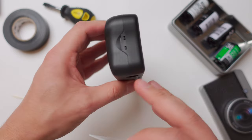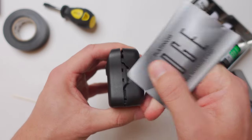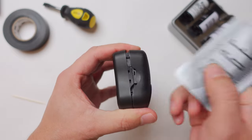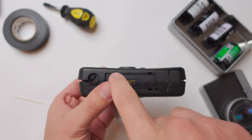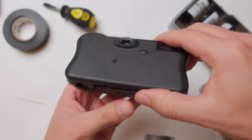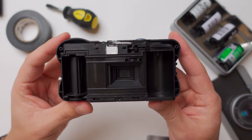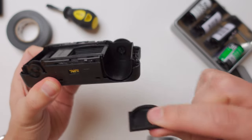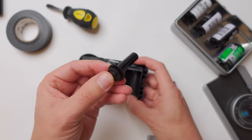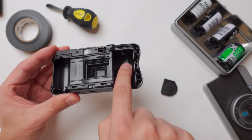It's time to show you how I reloaded the camera and how you can do it as well. Take your prying tool of choice — in this case a plastic card — and start opening the tabs on the sides. Once you've opened both of the sides, then move to the bottom of the camera. Do not force it too hard; these are just plastic tabs and don't require much force. The small tab located at the top is a little bit delicate, so to protect it, we're going to open the camera from the bottom just like this. You can go ahead and remove the little plastic protecting tab, and now you can remove both the film spool and the film roll from the camera. And voilà — that's all the moving parts that we're going to be using today.